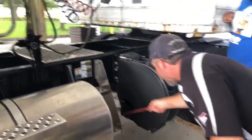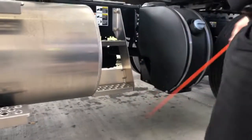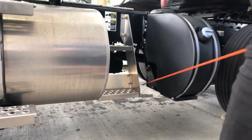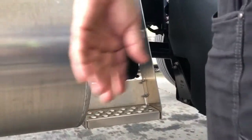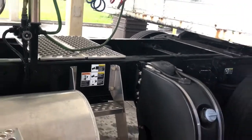Underneath there, I have the drive shaft in the middle of the truck. The drive shaft should not be bent or cracked in any way — cracked at the welds, cannot be twisted. Within all the U-joint connections, I have a couple of them there because it's a double shaft. All the U-joints have their bolts, and there's no debris tied up in the U-joints themselves.